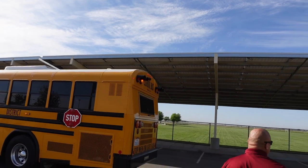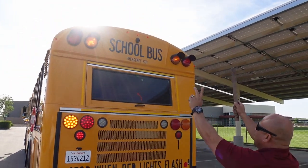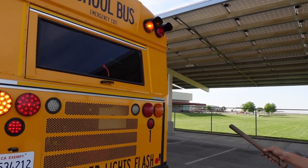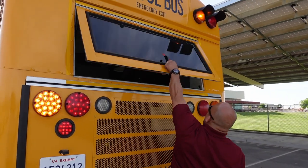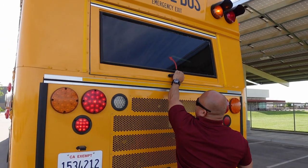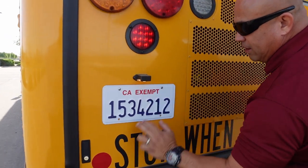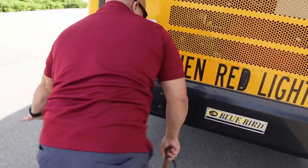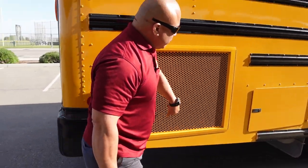Next I'm going to come to the rear. Starting at the top: clearance lights are working properly, my ambers are working properly and they're the proper color. 'School Bus,' 'Emergency Exit,' 'Stop and Red Lights Flash,' 'Bus 1' — all labeled properly. My glass is clean and free of cracks. Arrow is going up — lift my handle, make sure my door is working and the sill is intact. My left turn signal is working properly. My tail lights are working properly. My license plate is illuminated. License plate is secure. Reflectors are intact. Bumper is secure. Muffler is flush with the bumper and there are no visible leaks. Reflector is intact. Panel is secure. Battery door is secure.